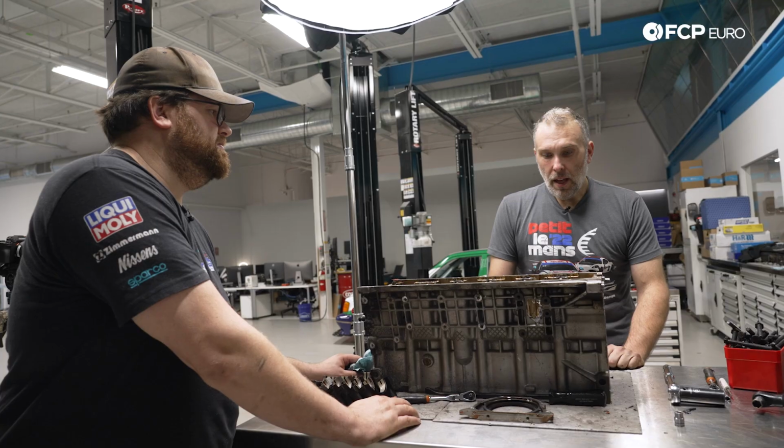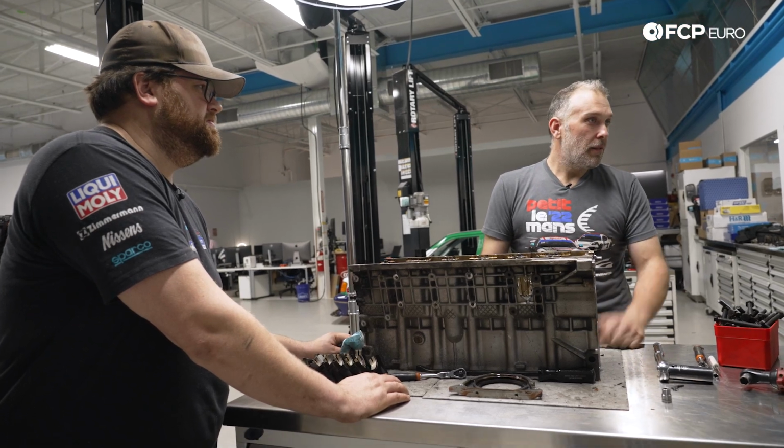Yeah, so if the piston made contact with the oil squirter, just because of an over rev or something like that, it's possible that the piston could have overheated, could have failed. Also, the wrist pin, which is a pivot point for the piston, could have seized up, which caused catastrophic failure. Everything seemed to fail around where the wrist pin would be. And then obviously once the wrist pin fell away from the piston, the connecting rod just did its thing. Yep. I think unfortunately cylinder number 5 was a victim of the over rev. So one simple over rev caused all that damage.